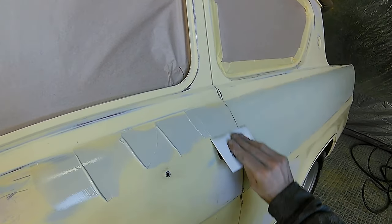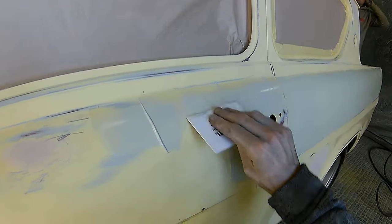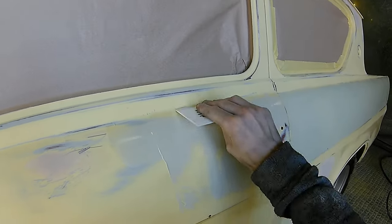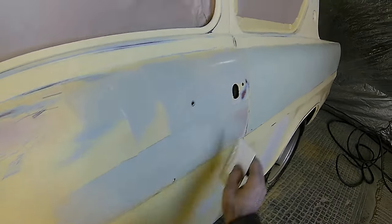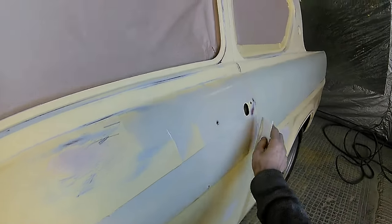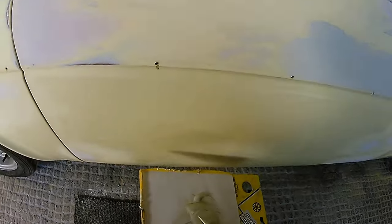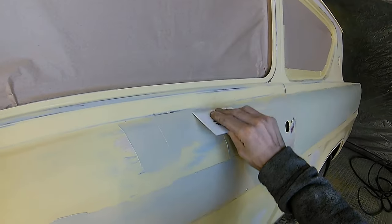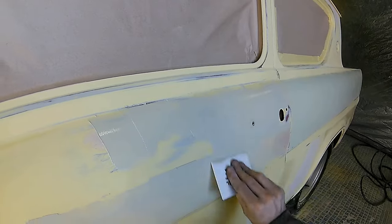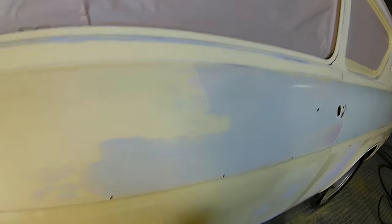So we're going to put this on as smooth as we can and try and feather this out so it really is just a really fine coat. Now I'd say this is probably only about 1 or 2 millimeters thick before we've even started blocking this fine filler down. So by the time we've gone over this in the two stages that we want to do, the first stage being a P120 on the long block again, nice and diagonal, blocking these panels out so we end up with a real smooth flat finish on these top sections.